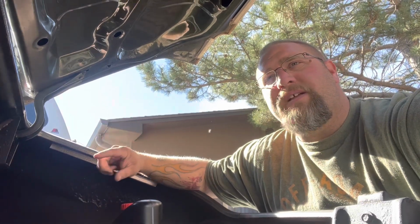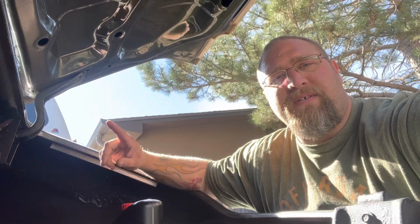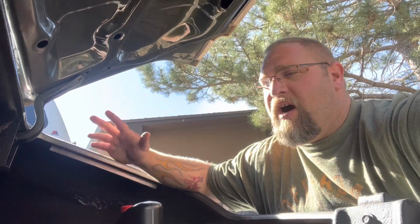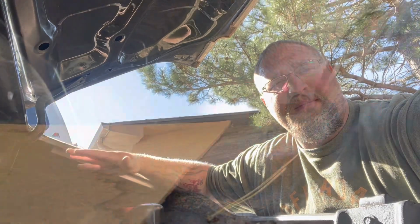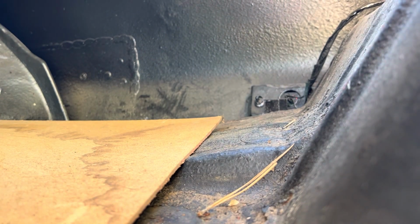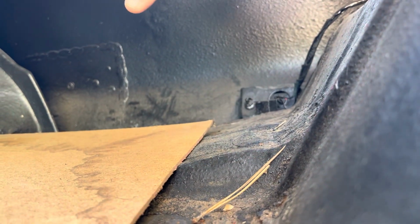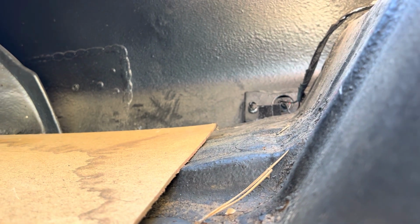So when you're moving it to the trunk, especially for an American car where it's left-hand drive, you're putting some of the weight on the opposite end from where the driver is, so you're balancing that weight out a little bit. And there's a lot of options of where you can move the battery. So here in the trunk, probably the best place, if this was just a drag car, would be moving the battery right back here. It's the furthest back part of the trunk. It'd be far to the right, so it would give the most weight with a fulcrum effect over the axle.